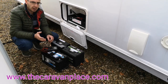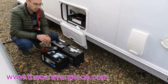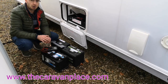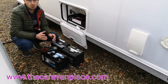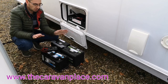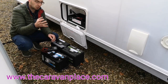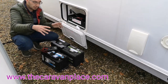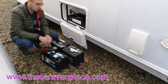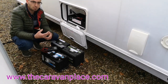Through the winter we use the caravan less so it's sat there longer. The cold weather deteriorates the battery quicker, and a lot of people come to the caravan around February or March to find the battery's completely dead, and then a couple of months later there's a rotten egg smell. That's basically the battery sulfating up — it's stopped working and when the charger's trying to put charge into the battery, it's just basically blowing it up like a bomb. That rotten egg smell means the battery's been destroyed because the leisure battery hasn't been cycled properly.